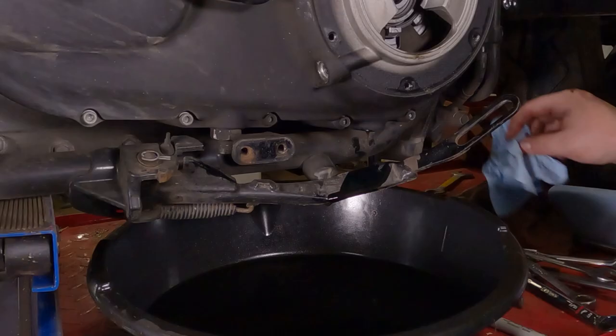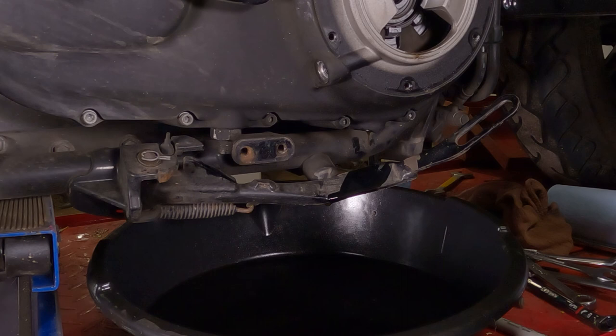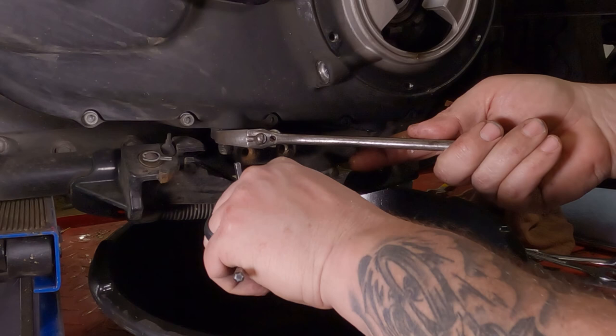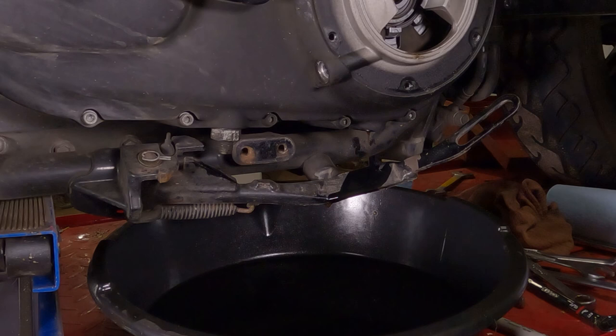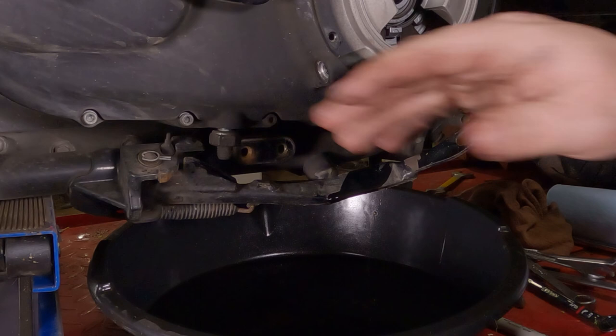To loosen up your primary chain tensioner, there's a big nut on here. Use the adjustable wrench. You should probably use a real wrench. And that 1/4-inch Allen goes down underneath and break that free. Also going to move very free because it's the second time I did this. Then just back it off a little ways. That'll let the puck drop down off the tensioner, which will make the primary cover easier to remove.